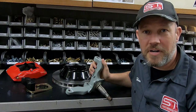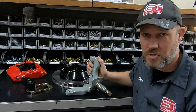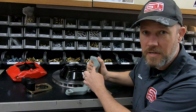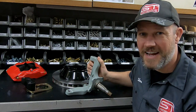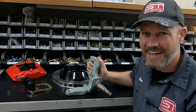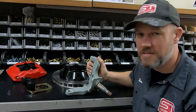So let's talk about brakes. The original idea was to have the spindle support the drum flange mounting pattern for the brackets that hold the caliper, as well as the disc version. The original disc version had a boss on the steering arm and a hole through the upright, with a bracket spanning between the two. But when we showed those drawings to Andy, our engineer, he practically had a heart attack — that giant hole in the upright was a no-go. The stresses and loads from the wider tires needed all the strength of a solid piece there.